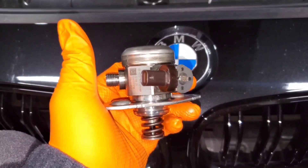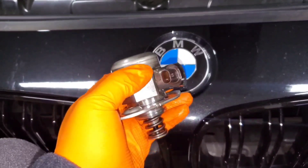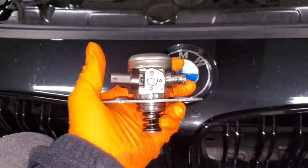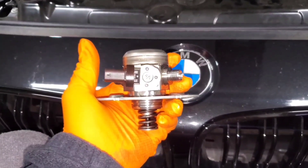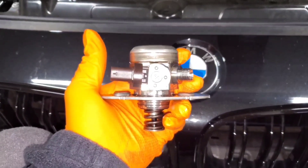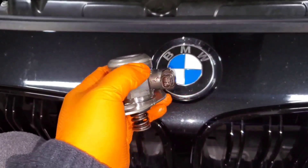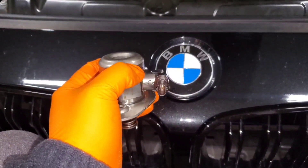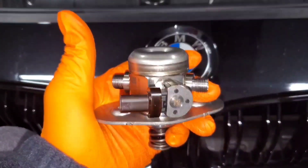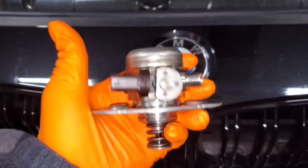A lot of people say you can't run this with E30 or you can't run it with full E85. Really, you can run this with whatever fuel you want. If you run full E85 you'll probably make less power than on E30 — that's just because the stock turbo isn't maxed out, so you don't really need more octane and all you're doing is limiting how much boost you can run. You can run whatever fuel you want with any fuel system you want — you just need to control the boost level and keep everything within a safe AFR range.